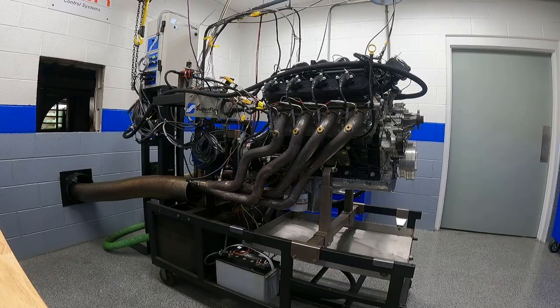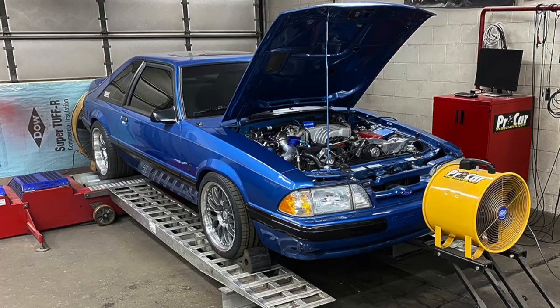There are chassis dynos, hub dynos, and water brake dynos. Most fundamentally, an engine dyno — a water brake like the one here — measures power and torque at the flywheel. A chassis dyno or hub dyno measures power either at the tire or at the wheel. With a hub dyno, you take the wheels off and plug right into where your wheels bolted on, measuring power there — especially critical for high-horsepower cars with no tire slip.